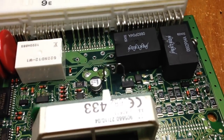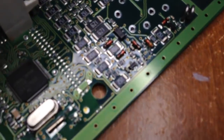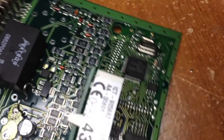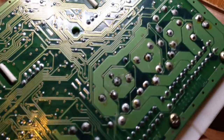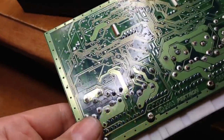So you can see we've got one out, two are now loose, one's nearly out - give it a wiggle to loosen up all the joints. That one's out. One of the problems is cleaning up the holes. That one actually is not too bad with quite good holes, but this one over here is probably going to require some solder sucking out of the hole. It probably helps to get somebody to hold the board and hold the solder sucker at one side while applying the soldering iron on the other side, and then while the solder is melted, applying the solder sucker. There we go - with the new relays fitted, these three are all soldered up underneath. It's quite a tricky job - helps to have somebody holding the board while you use the solder sucker. Put the solder sucker on one side and soldering iron on the other, and eventually manage to clear out all the holes and resolder the relays.